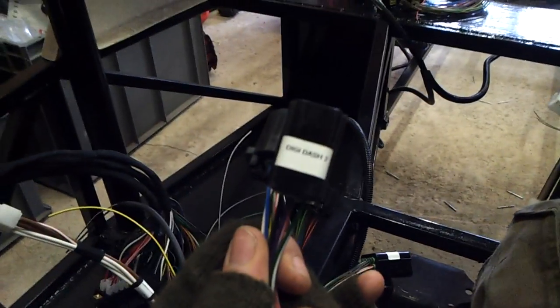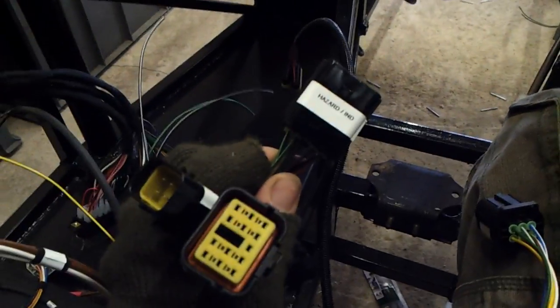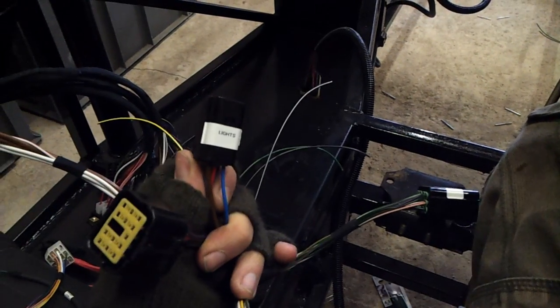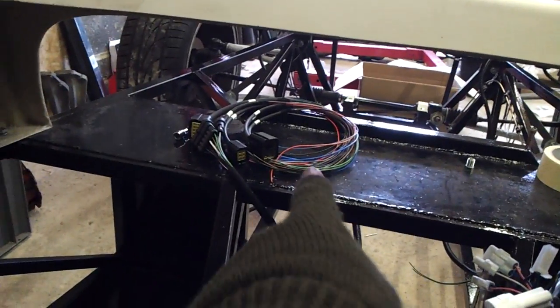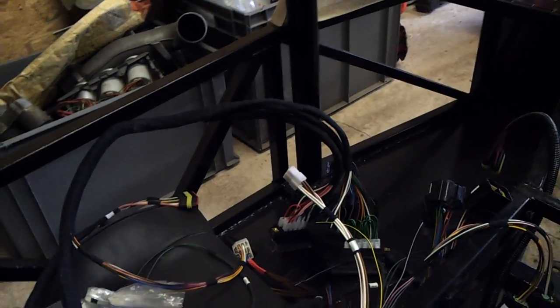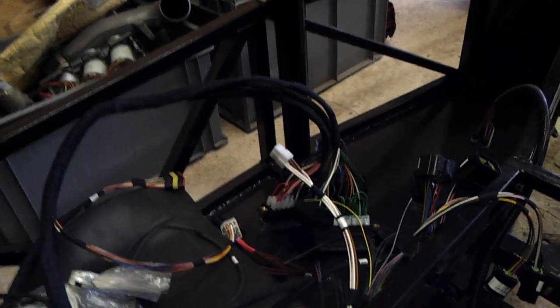As you can see here, I've got the DigiDash, I've got the hazards, I've got all the switches. It's all levelled up nicely to go in — lights and everything. This all connects to the Sierra loom, which splices into those plugs. It's all modular, so I don't need to put it all in place first before I wire it up. I can just literally wire it as I go and install things, which saves me a lot of time.